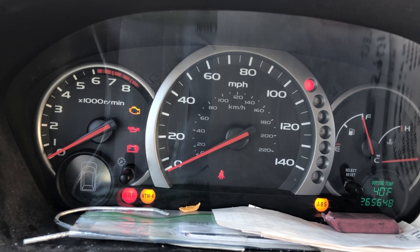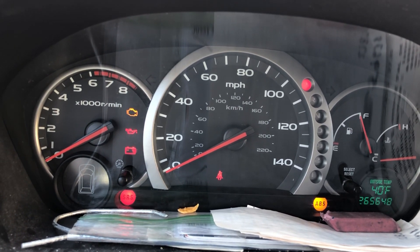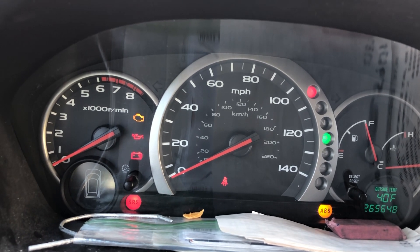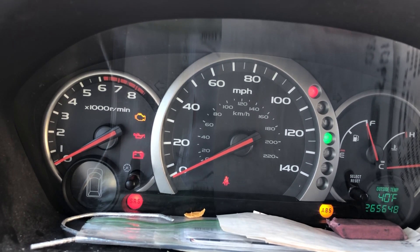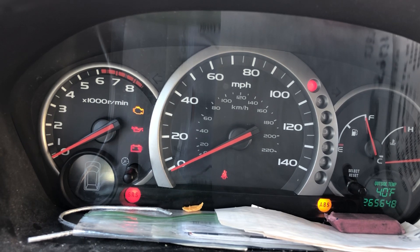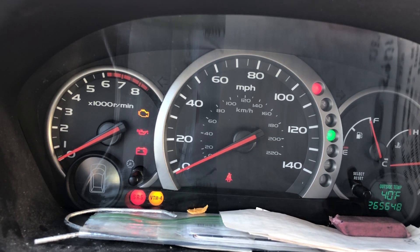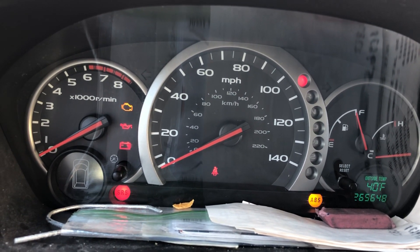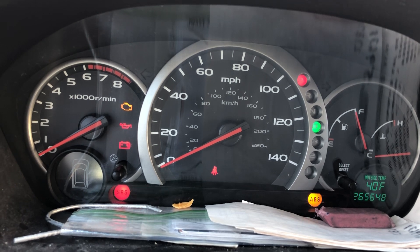What I'm thinking is that those codes might all be associated. I think the big one is the flashing D light. I'm going to go ahead and replace those pressure switches and see if things change. This is complex and I'll have to watch my own video to recount, but I hope this helps you all out if you're having similar trouble. It doesn't necessarily mean your transmission is done, but those things have to be taken care of for the longevity of your vehicle. Thanks for watching — please like and subscribe, and have a great day!